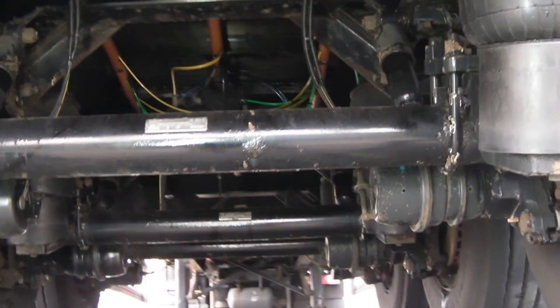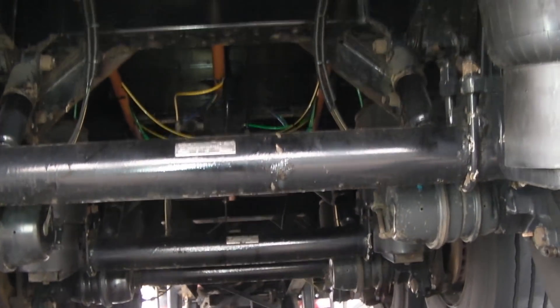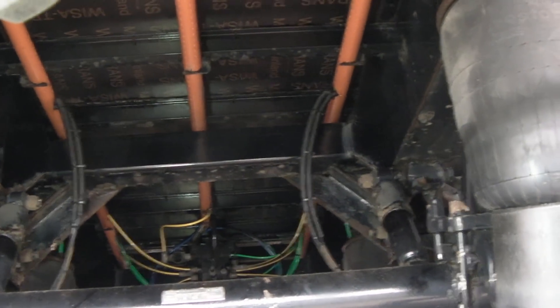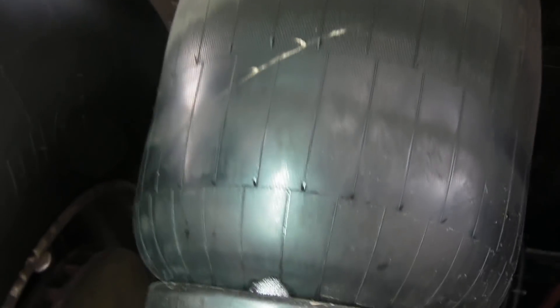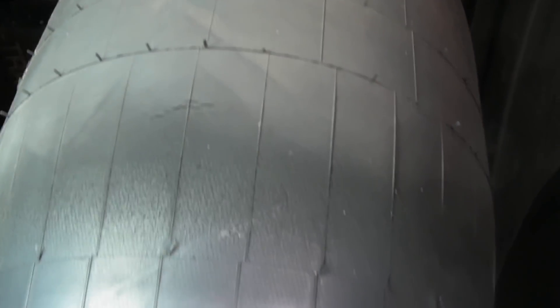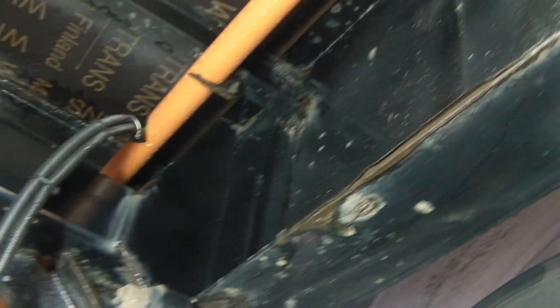From a distance it doesn't look like it's been pepper-shotted. The paint on the rear end of the axles is in quite good condition. Now, just for you HGV guys — an airbag with a cut in it has a leak and is an MOT failure, whereas if the cords are exposed or you have perishing on the airbag, it's actually not an MOT failure. But I'd still change them because it shows the age of the airbag. Both of these are failures, and there are actually five airbags to be done on this trailer.